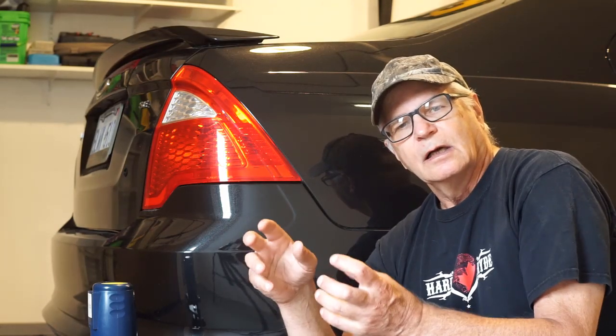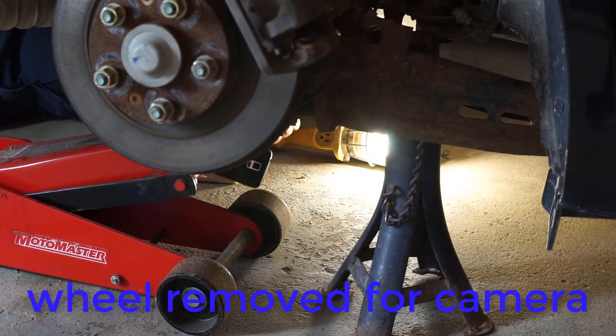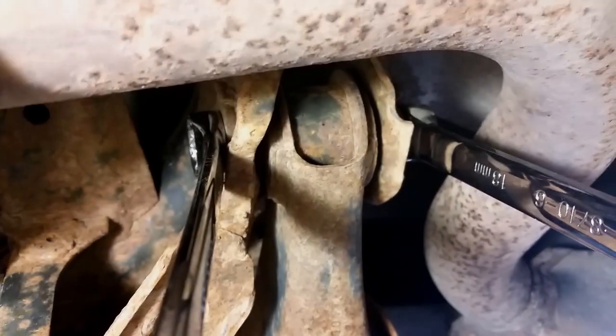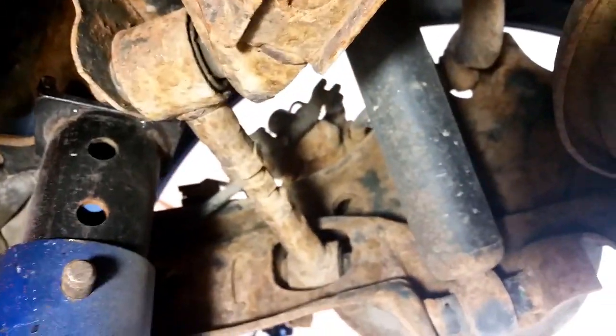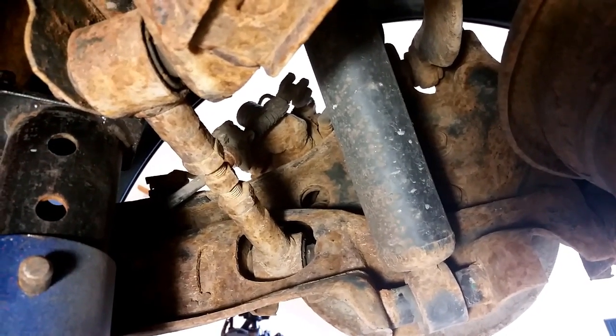So it pretty much means that I'm going to have to get my coveralls and crawl underneath there and see if I can free up those cam bolts that adjust the camber. I moved it two notches on the cam — we'll see what that does. This will have the effect also of changing the toe adjustment, although that's the subject of the next video. While I'm here, I'm going to put a little bit of penetrating oil on that turnbuckle. I'm pretty sure that I'll end up having to move that.